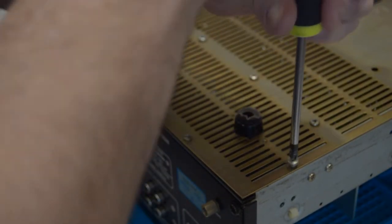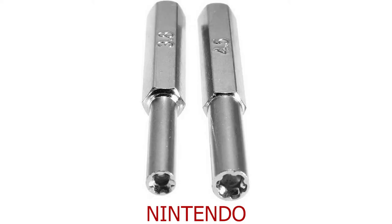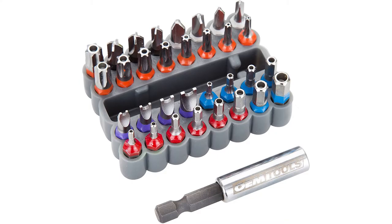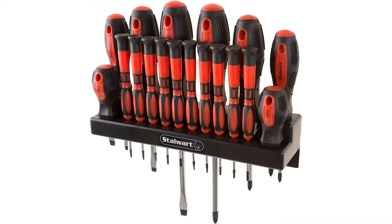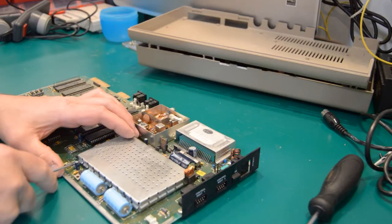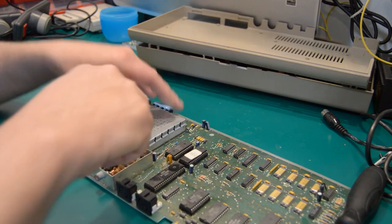When working in electronics you'll notice that the most popular is the Phillips head. However, you can't get away with just a flat and Phillips screwdriver. There are many gadgets and game consoles that use hex or Torx. A small kit containing a mix of all these is a good place to start and should cover most of your projects. You'll also want different sizes — a tiny flat head can be very useful in unconventional ways to facilitate access to small areas.